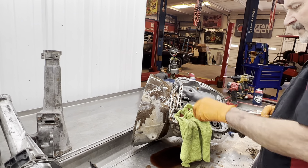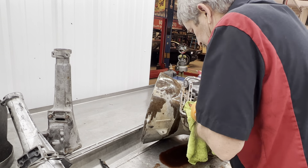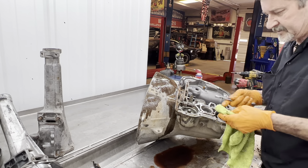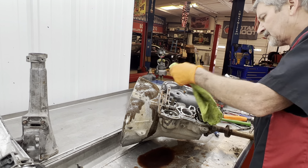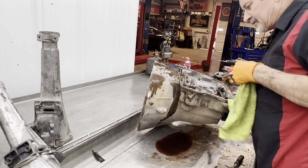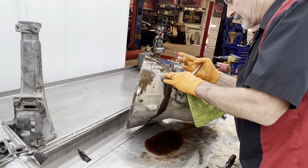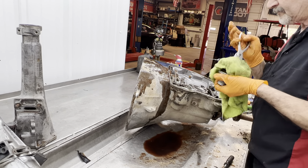If you're going to pull this servo out, you don't want to grab the pin with pliers without some type of cushion. These things will cock, and it's hard to get them past the snap ring groove because the ring wants to jump out in the snap ring groove. You just kind of work it and try to get it out the best you can. Some of the Teflon ones are really hard to get out with the Teflon rings — you just have to cut them carefully.